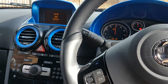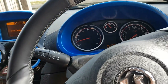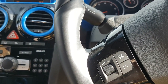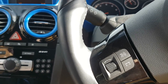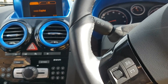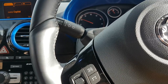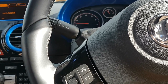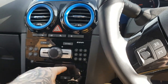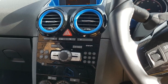This is what it sounds like with no leaks — this car also has a Power Flow exhaust on, so it will sound a bit different. Important note: do not turn the key until you've put your O2 sensor back on, because if you do you'll get an engine management light, and if you don't have the equipment to clear it, it will cost you money. So that's how you fit a pre-cat. Thank you for watching — I've got more videos coming: I've ordered a new stereo, I've taken the carbon fibre wrap off because I didn't like it, and I'm thinking of going matte black. See you again soon!